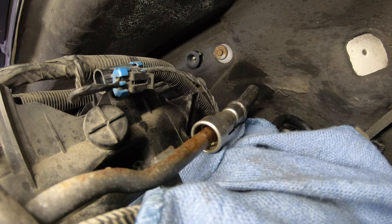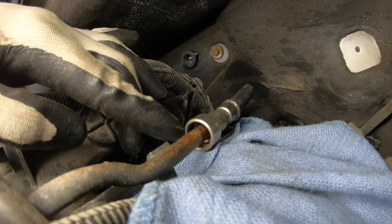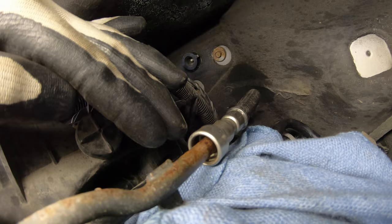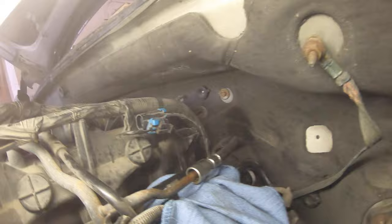What you need to do is — watch closely — did you see that move? It moved maybe a sixteenth of an inch. But what that did was it created a gap between the barb and the lip, and that's going to allow you to push it down. So you need to hold this and put the tool in at the same time, but it's got to be pulled towards you to make sure that the barbs are free.